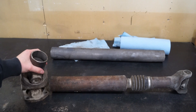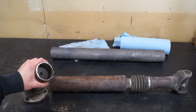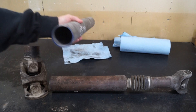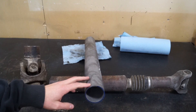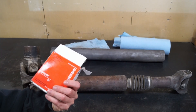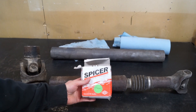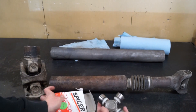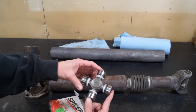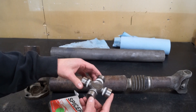This particular driveshaft came out of a Ram 2500, however it's too short, so I will need to use this piece of tubing to extend it. It'll connect to my Dodge transfer case, but not to my Ford front axle. To make it work, I'm using this Ford big cap U-joint, which has 1310 size caps on one side to connect to the Dodge driveshaft, but then closer to 1330 size caps on the other side to connect to the Ford axle.